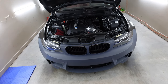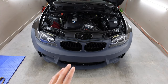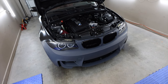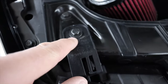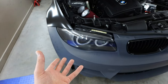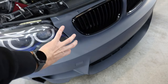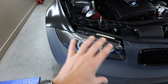Off camera, I actually went ahead and fixed all of the gaps on my bumper to fender setup. Originally when I installed the front bumper and the 1M fenders, I had some pretty wicked gaps happening right between here, and I figured out exactly how to close those and get them perfect and flush. It looks really, really good now. I removed all of the stuff on the front end and also loosened up the entire headlight bracket. I made a couple of little modifications - I actually dremeled out the lip right here and also dremeled out the hole, which allowed me to push the entire headlight in a bit further. The bracket is what determines how flush this can fit, so you really need to make sure that bracket is all the way up and in to fit as good as possible.